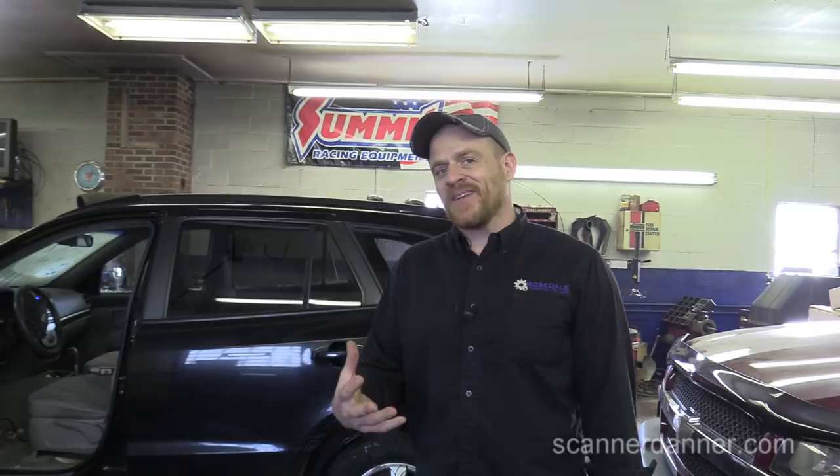We are working on a 2007 Hyundai Santa Fe that does not start, and I'm excited for a couple reasons. One, it's a no start we get to troubleshoot. Two, I have a friend on Facebook, Matthew Scundrich, who had a 2008 Santa Fe and posted about it. It had a new ECM, no spark, good injection pulse, good cam and crank signals, and no immobilizer issues. His homework found that these models don't have an immobilizer — only the Canadian models did.